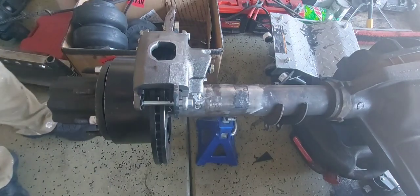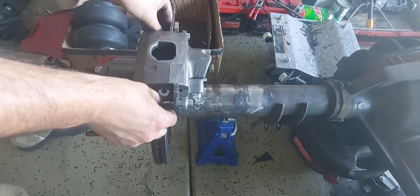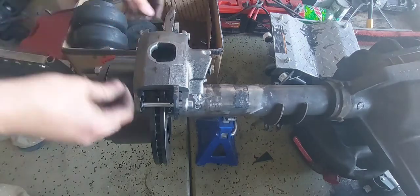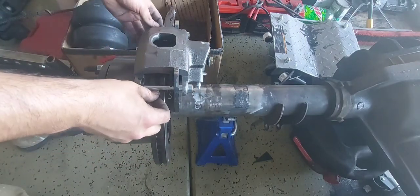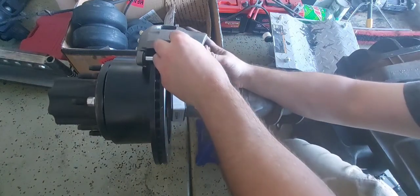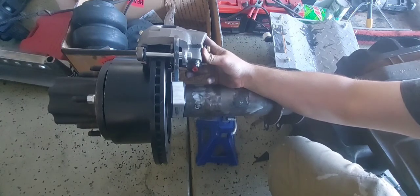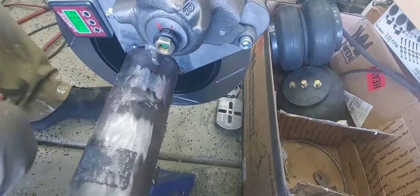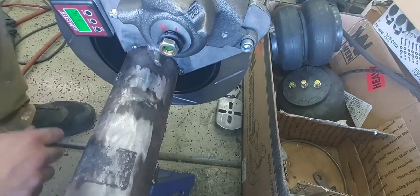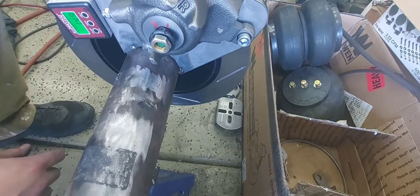Once you've got them snug, the caliper is on there nice and snug. Now you need a couple of spacers — 1/16-inch washers — just place those under each of these pins to make sure you've got enough space in there. This side's good. Run it to zero to match the other side. Then we're just going to throw a couple tacks on the inside of this bracket. We've got the e-brake essentially on so it can't turn on the rotor — that's going to square up your caliper with the rotor in the bracket.